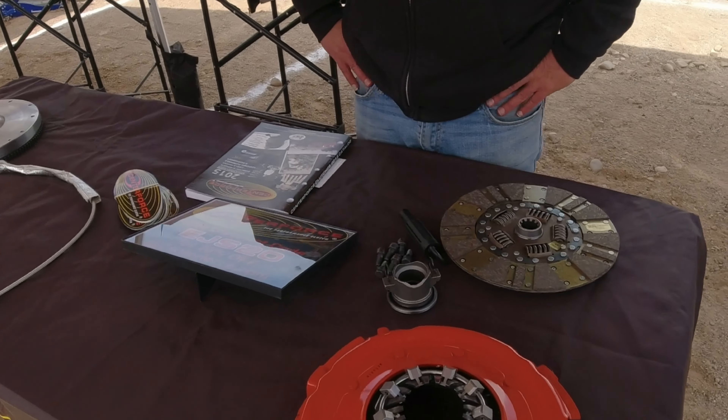There are a number of things on the inside of the pressure plate to improve engagement, improve release time, things of that nature. It took a while on the JL to get all the factory stuff addressed, but we've got it done now — we're in production. We've got a lot of back orders to fill, but we should be able to fill orders fairly quickly. We also get rid of the plastic throwout bearing, which was another problem — we have a much improved, sturdier metal throwout bearing.